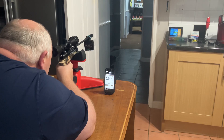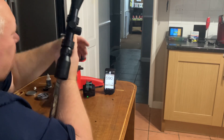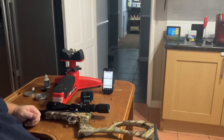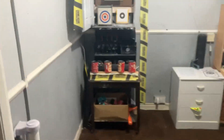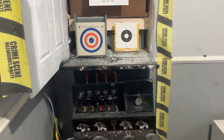That's our 10 shots done — let's look at the target and the chrony results. The standard deviation is 5.4 fps, so I'm very pleased with that. That is exactly where it should be. Still a standard little gun — it shoots absolutely superbly. I've not tuned it, I've just made it back to how it possibly should be. I've got a feeling that was just a machining error on SMK's part; these are mass-produced and they are cheap, so you can't grumble. You can see it still shoots a lovely little one-hole group — I'm very happy with that. Thanks for watching.